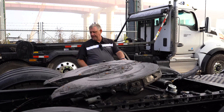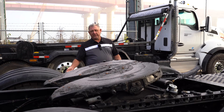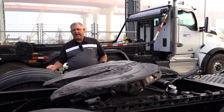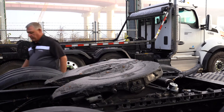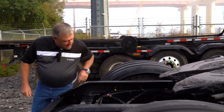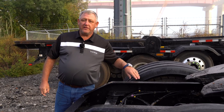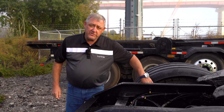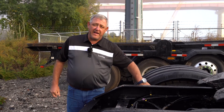We're also going to look at what type of wheels it has. This one has aluminum on the outside, and we need to make sure it has aluminum on the inside also. Coming around to take a look, this one actually has steel on the inside. While we're here, we can see which brakes we have — this one happens to have drum brakes. Remember the front had disc brakes, so if this had disc brakes front and rear, that would be an upgrade we would make note of.